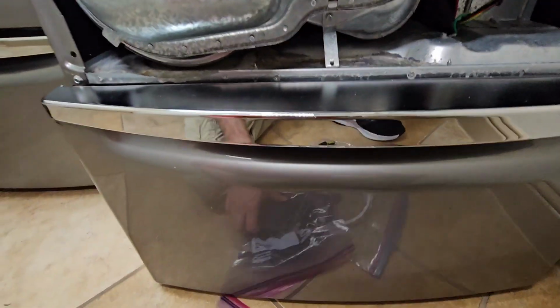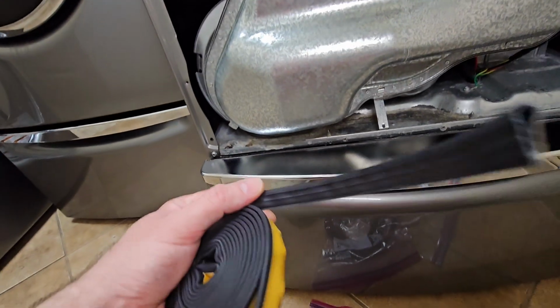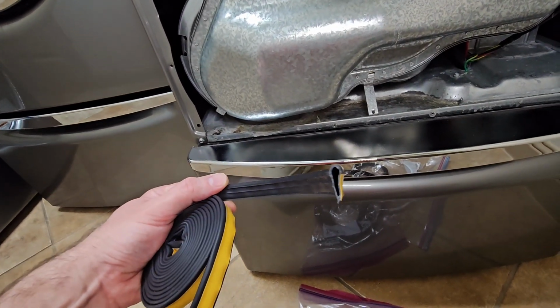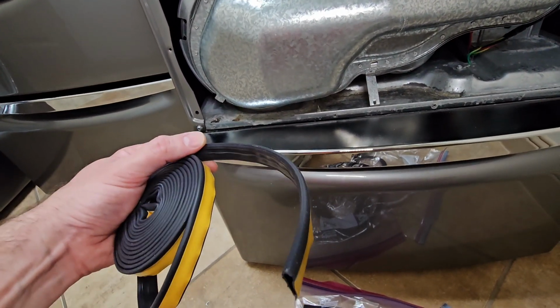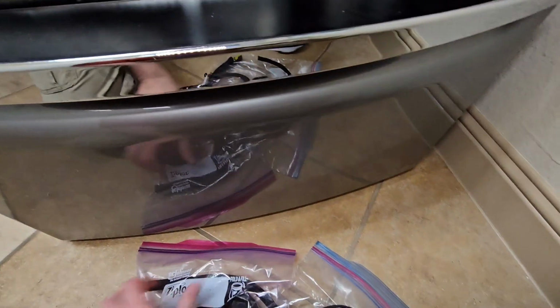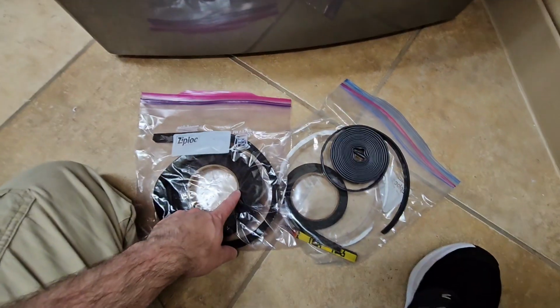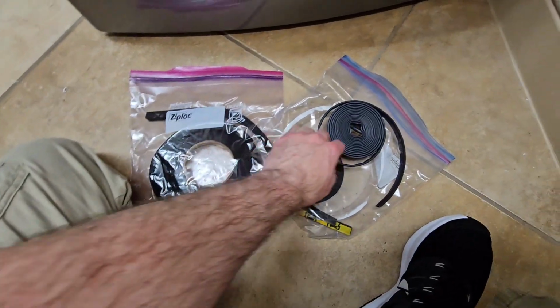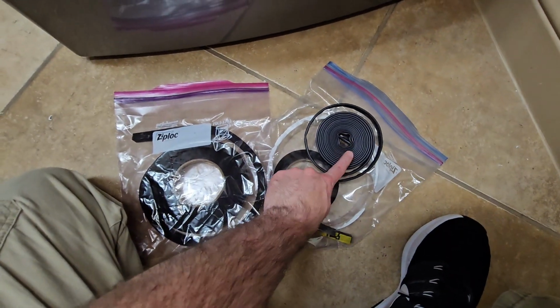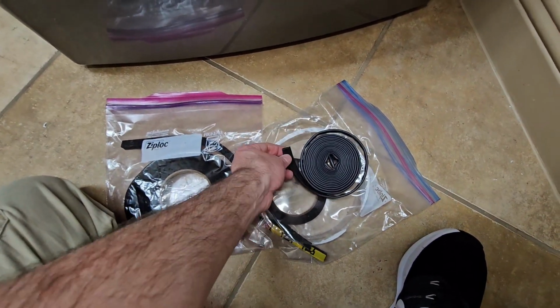And then in terms of the seals, this is a silicone seal, which is a high temperature seal. You can see that it has an air gap in it, so it's flexible, right? It's a kind of flexible seal. Double-sided sticky tape on the backside. Here we have the expanding foam seal, okay? Both of these I picked up at Home Depot, but I'll put a link in the description to pick these up on Amazon as well. The silicone one is obviously pretty expensive. I think it's between $20 and $30 for a roll of this, but that's because it's kind of specialty.